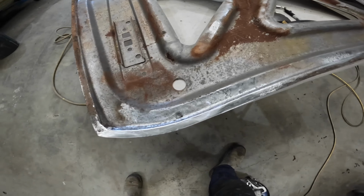It's an original boot here, typically rusted on the corners, usually on the skin on the frame too. Here we're de-skinning the original skin from the boot skin, linishing down the edge so that you can peel open the edges like you see here. From there you can peel the skin from the frame and the small inner lip there as well. You can remove that.